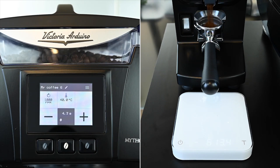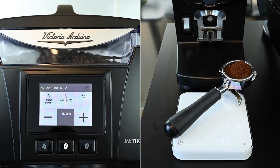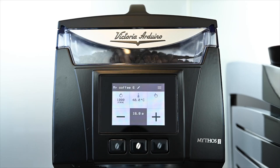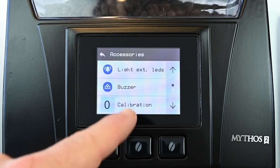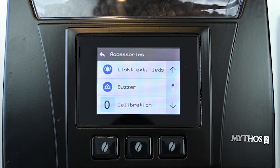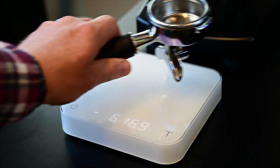If we grind a second dose to verify, we can see this is also out by 0.8 grams, so we need to calibrate the scale in the grinder. The average of the readings showed the grinder was dispensing 0.8 grams less than what we required of our 18 gram dose. For every 0.2 gram difference, we need to adjust our calibration by 0.1 of a gram. To calibrate, go to the main menu, scroll down to accessories, then calibration. As our grinder displayed an average of 0.8 grams more than the external scale, we need to minus 0.4 grams from our grinder so the scales are calibrated. Select confirm, exit to the main screen, and now time to test the results.